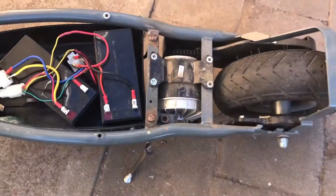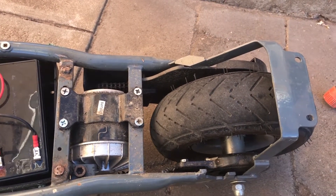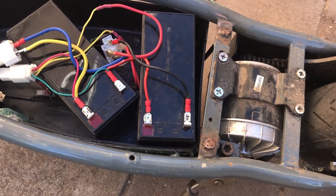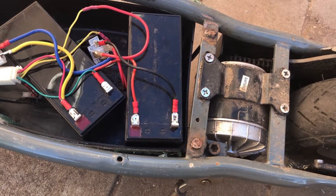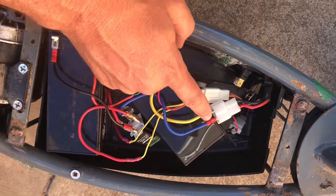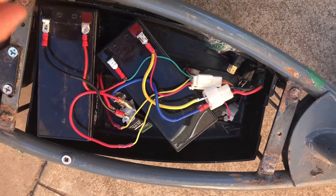So clearly it's working there, however the motor's spinning in the wrong direction. So in order to rectify that, I need to swap it around — we've got the positive and minus the wrong way around. The simplest way to fix this will be to just swap over the connections that are coming straight in to drive the motor, so I'll just swap them around the other way here.